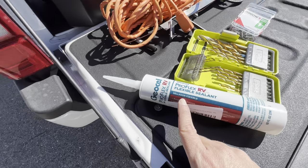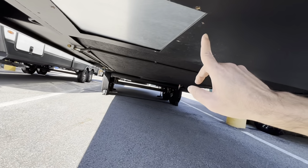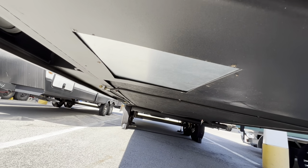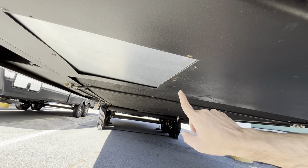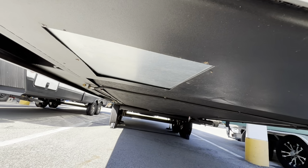But for now, I gotta mark the holes on the sheet from under, like here, here, first, to see where I want those holes, and then put the rivets, and then probably when I have an extra gap, I probably will put an extra rivet right there to try to close it. Let's do that.